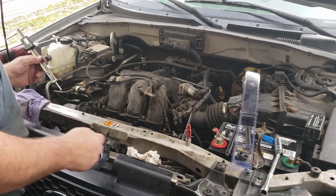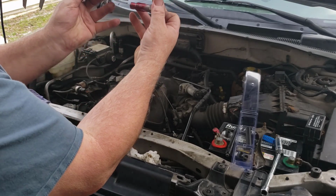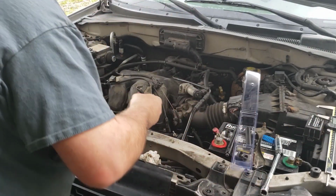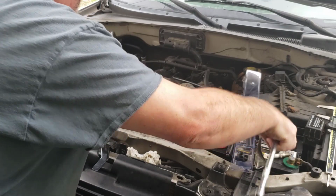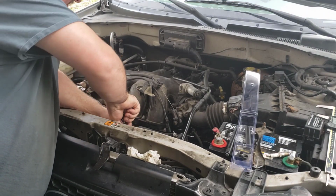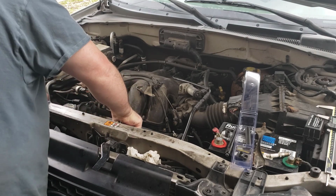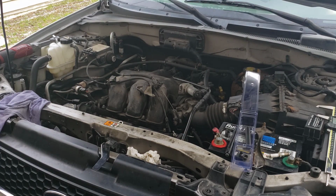What in the thunder did I do? There it is. So it does look like I'm going to have enough room to tap it. So we'll switch the spark plug with the tap here and easily, hopefully, turn it in there. I say hopefully we'll turn it easily. I really did a number on ripping the threads out of here. There's no guide left at all.